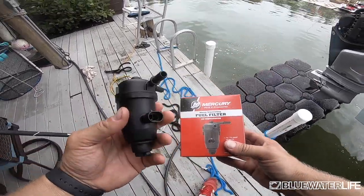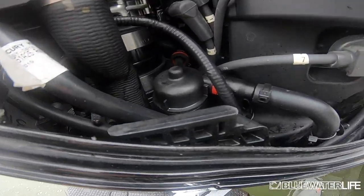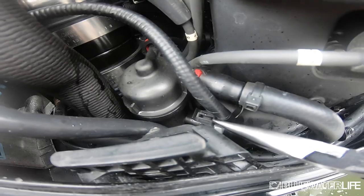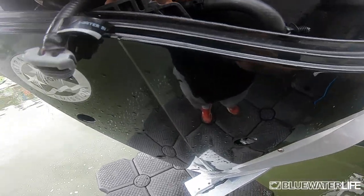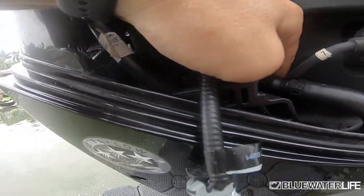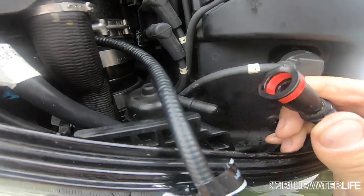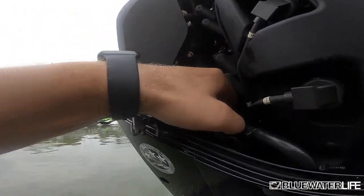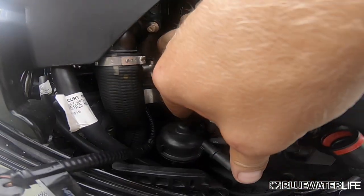Your next step is to remove the fuel filter — it's just one piece and pretty easy. It's on the back end side of the engine. First, there's a pin connector on the bottom side you want to pull off. Then use your hands to get it the rest of the way. There are two red connectors — press down on both and you'll hear them pop off, then slide those tubes off the back end. Now turn the filter and it will pop out of place. Don't pull straight up — there's a groove on the bottom, so turn it first and then pull straight up.